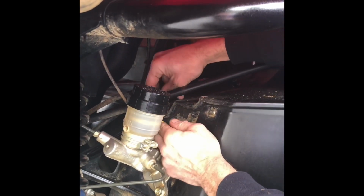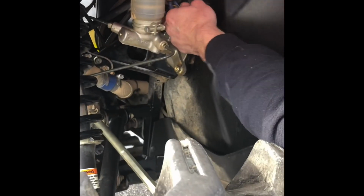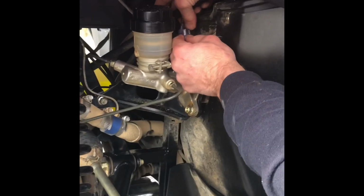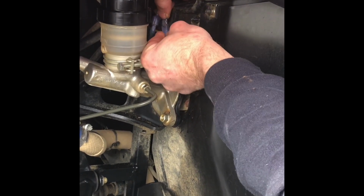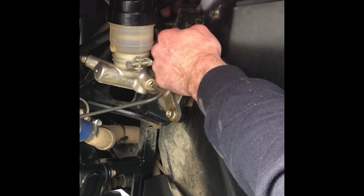And you will take your connector, making sure you come in behind your shifter cable. You'll plug in your switch, making sure you get your prongs lined up. Okay, we have our switch connected. Now we have two more connections to make right at our actuator. And then we will go inside and show you how it works.